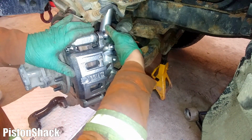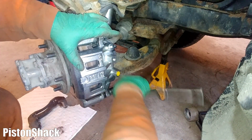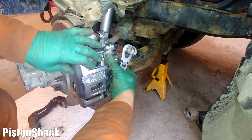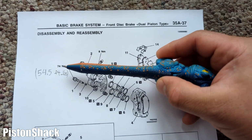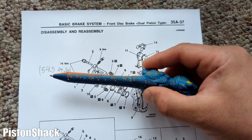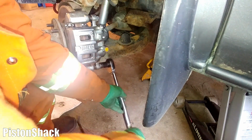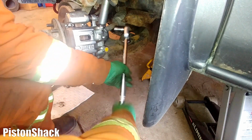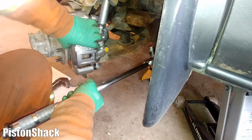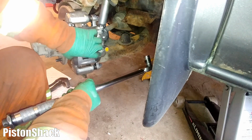All right, let's just tighten the bolts. Torque specs for the guide pins: 74 Newton meters or 54.5 foot-pounds of torque. Guide pins. Torque specs will be down in the description below under the video. Here we go. All right, nice. Yep, boots are on. Everything's sliding freely.